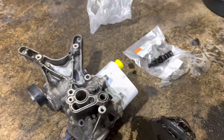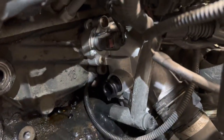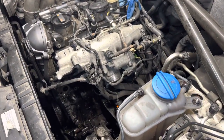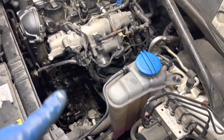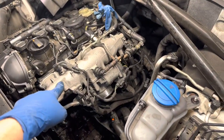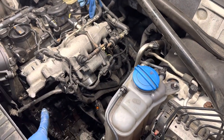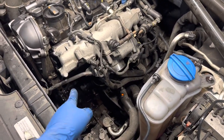So we ended up replacing the gaskets, replaced the oil cooler for good measure, and we did the water pump a few days ago. Every video I've ever watched and the manuals tells me I have to remove the manifold and the water pump just to get access to the cooler.